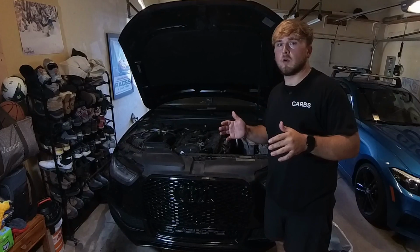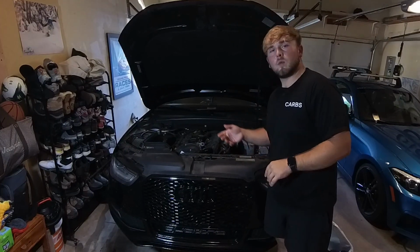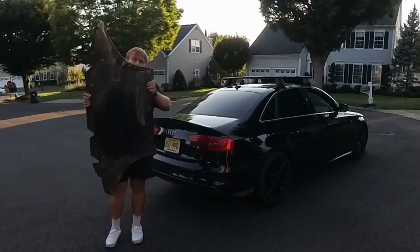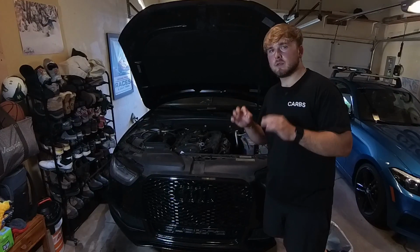All right, once you do all that, you're gonna hit a little startup, double check that there's no leaks, no faults, no problems that you could have messed up in your garage. And then right after that, we'll reset the MMI, take it for a road test, come home. And then I like to leave the bottom skid plate off just for the road test so that when you get back, you could check one more time for oil leaks.